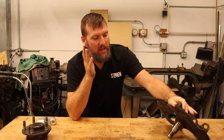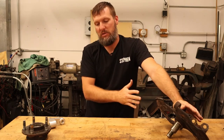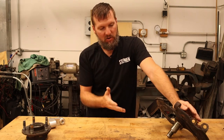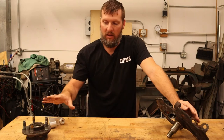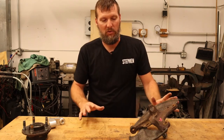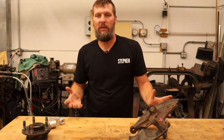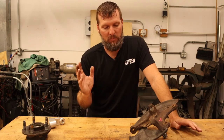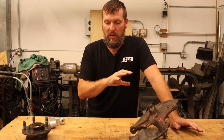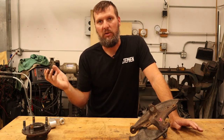I plan to use the SN95 spindle. I have the adapter for it, and as mentioned, this spindle has been used for countless SLA suspensions on Mustangs in the past. It has all the criteria I want: it uses an easily attainable hub, it has all the attachment points for the components I'm using — the brakes, the steering — so I don't have to reconfigure anything. I can just put the spindle in, and I know it will work since I'm using a stock K-member at the moment. Bump steer will be minimal and I'll be able to adjust it as I've done with the car currently.